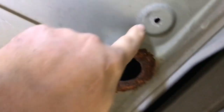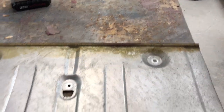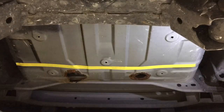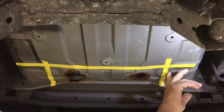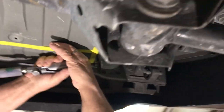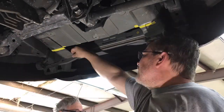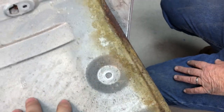We're going to cut out the bad metal on this bottom and use that as a template to trace it out so we can cut out a perfect piece to go up in the hole. Then we're going to bend this lip right here up so it'll give it something to sit against the rear body panel.